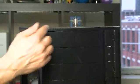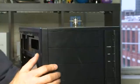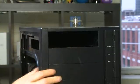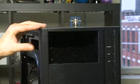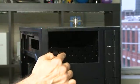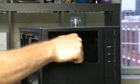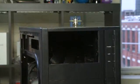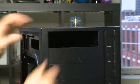Usually your optical drive will live at the top front end of your computer and it has a few guards in place when there's nothing in there. You can typically reach in behind and pop these out. If you already have something in there and you're installing a second one, you can do the same thing with one of the ones below, but you may run into a guard inside the case. You can generally twist these out without damaging the case itself. We're just going to install something into the top bay, so we don't need that.